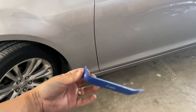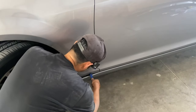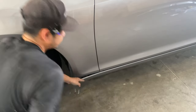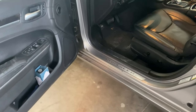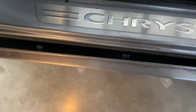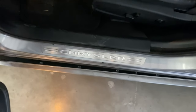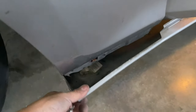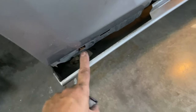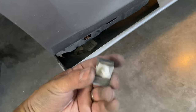There's two of them. You actually need something like this to wedge in there — if you just pull it, it might break. Let's open the door area. It's just held on by those clips. All you have to do is pry down on it and it should release those clips. You don't need to take off the whole side skirt — all we're trying to do is get this side down a little bit. You can see this thing broke — it was held on by this piece, but it broke because of the accident. So it might actually break if you just pull it off, but that's what it looks like and that's what this thing is held on by.